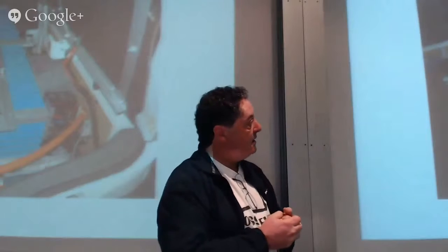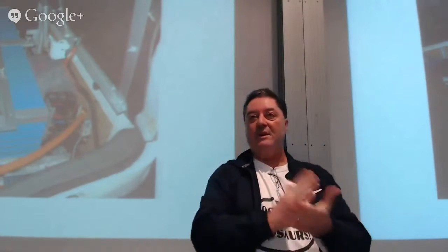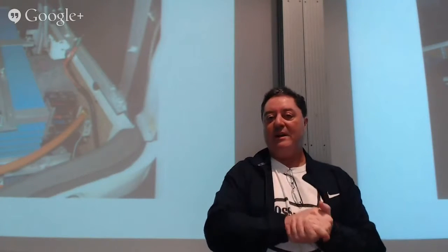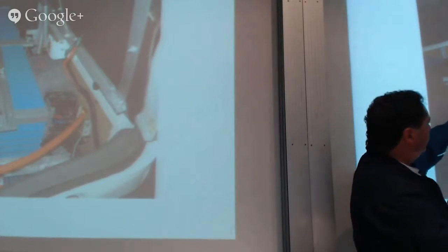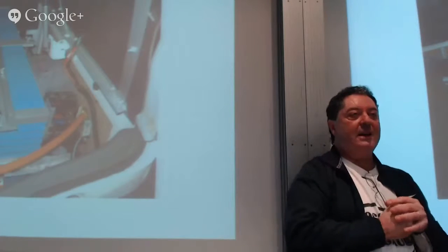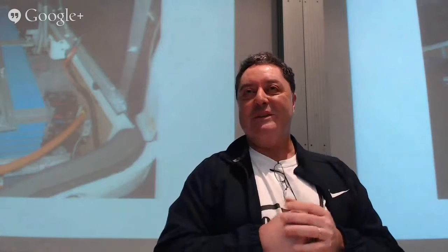At the rear of the battery pack, which also lifts, is the main contactor, as you can see, and there's the auto pre-charger. It pre-charges before it makes contact because of the high voltage that's going through it. And that's well at the back and protected and covered, as are all the terminals. You can note all the plastic in front of the main connectors. It's all protected, so you can't accidentally touch it. Well, you'd have to touch both positive and negative to do any damage anyway. Just touching one's not going to hurt you.